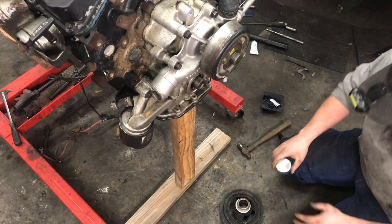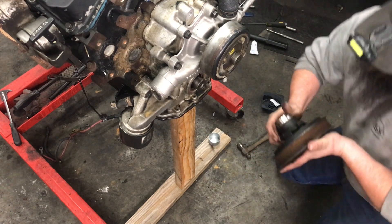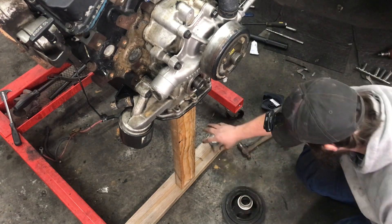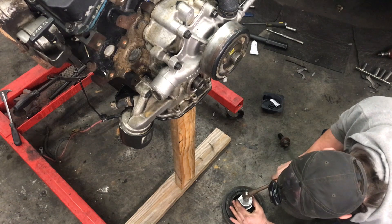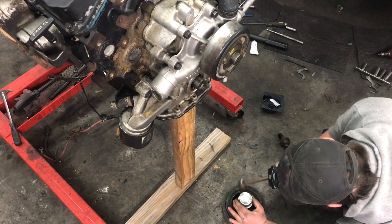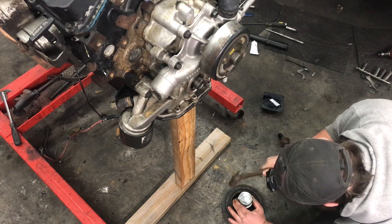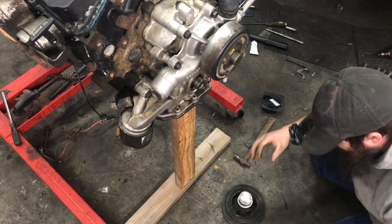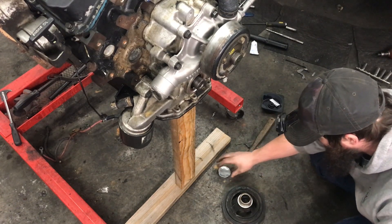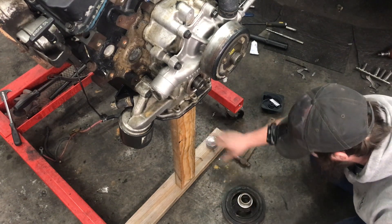As I was driving it down, you heard the tone change when I was hitting it. That's because the tool is trying to bottom out right here — got just a little bit further to go and it'll really change sound. You hear that? The sound's getting really sharp. The installation tool is a one-time use. It works a little bit better if you actually put a block of wood over top of it and use a big hammer, but that little hammer will get the job done.